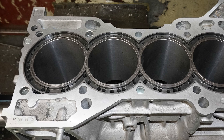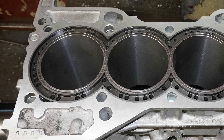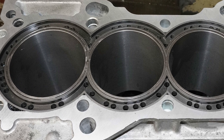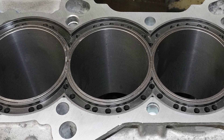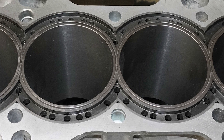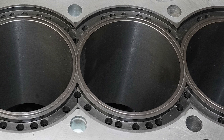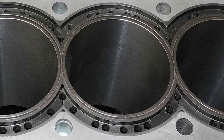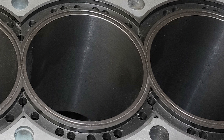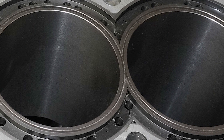As you can see from this picture he sent me a couple days ago, he did install the cylinder sleeves into the block. The Darton MID sleeves are installed and he put the receiver groove in the top of them, where the stainless steel wire installed in the cylinder head will push down onto the copper head gasket and push it into those grooves on the top lip of the cylinders.